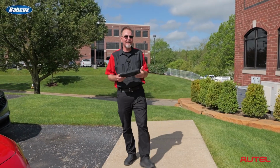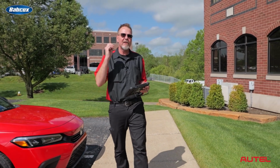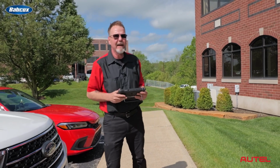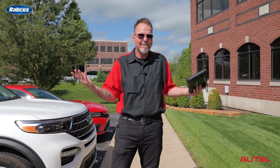Nothing more frustrating as a technician when you got a blinking TPMS light on, but no DTCs. One thing to think about that technicians might not be aware of is that some aftermarket electronics, such as ham radio equipment, maybe a cell phone charger, or even high tension wire lines, can cause TPMS interference. So it's a good idea, take a look around in the car if you got a light that won't go out.